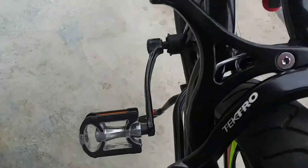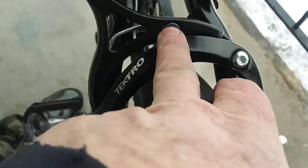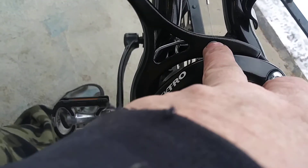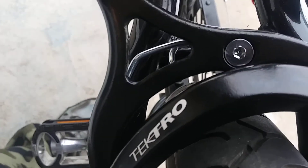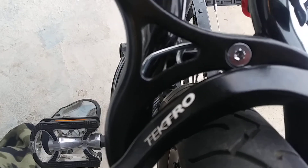I know a lot of you have never seen this done. I take the fender off, line up the stud that holds the fender into place, and then I just center punch it out. Then I use a small pilot drill bit and work my way up until it fits the size, going slowly. Being steel, I don't have to worry about the aluminum splitting.